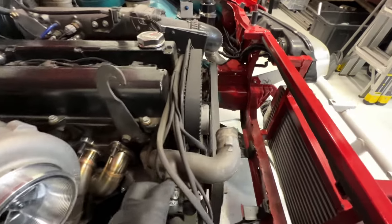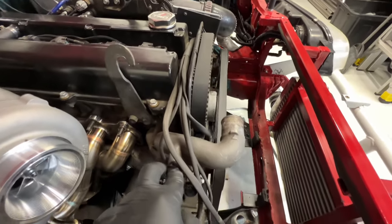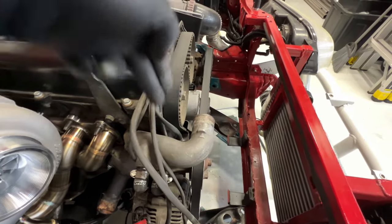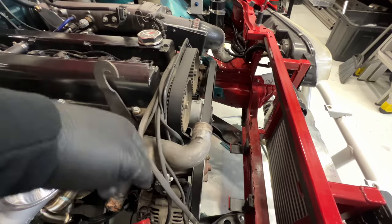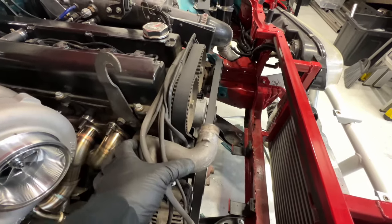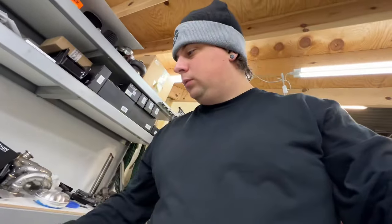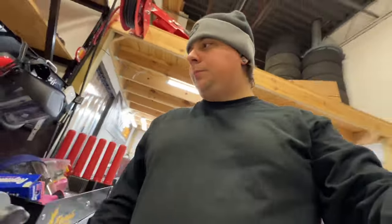I'm going to take that off, figure out a way to notch, use a 2.5 inch hole saw to cope the end of this outlet to match perfectly onto a 2.5 inch tube, like on the side. I've got something I can show you with.